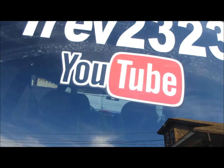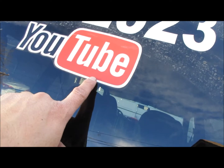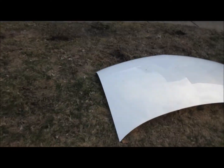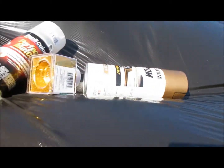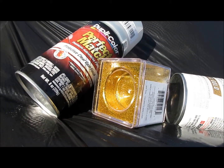I still got this YouTube sticker up here, going on two or three years old and it's still in color. I cleared that with Dupli-Color, otherwise it would have faded out like this right here. Dupli-Color is car paint - it doesn't have a hardener in it but it's got a UV protectant. I'm gonna scuff this up in the basement, wash it off really good, then probably do two or three coats of the gold and on the second coat I'm gonna sprinkle some metal flake on it.